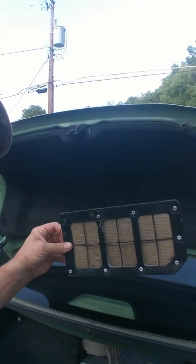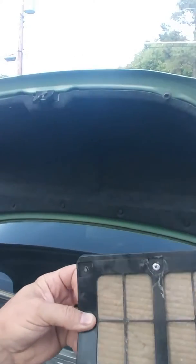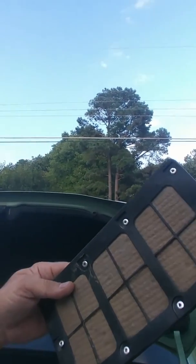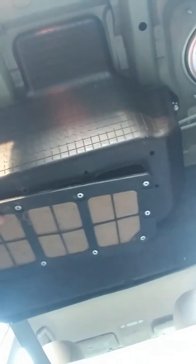This makes the computer think the battery is getting too hot, and it's probably overheating the battery. This is the underside and it's very dirty, as you can see. What I'm going to do is replace this and then rivet it back on to where it belongs. So that's how you take care of the P0A80 code — if it's not throwing any cell codes and you're not getting any bad module codes, just that one code, most likely it's the dirty fan and filter. Thank you for watching.